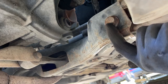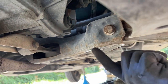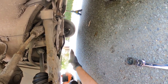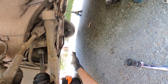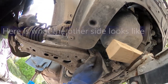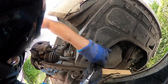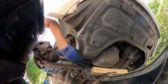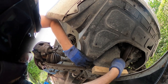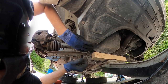That's it - just pull it out. Next we need to remove this nut at the front of the suspension arm. Do note this is on the left-hand side of the vehicle from the driver's perspective. On the right-hand side you will need to jack up the engine slightly and probably loosen the engine mount as well, just to get the engine out of the way, because the sump falls on the nut as you remove it. To get access to this bolt we can't get the socket in as it stands because the sump is actually in the way, so we need to apply a little bit of pressure jacking up on the sump.